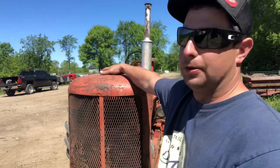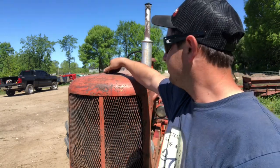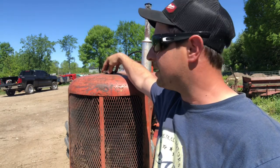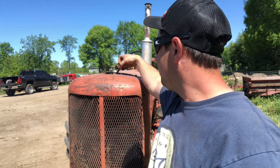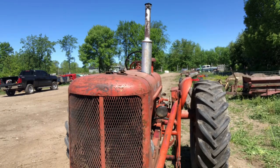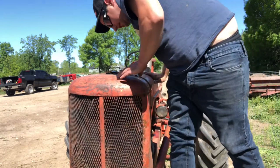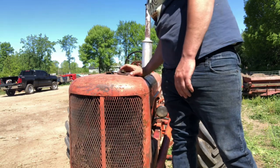So for your first check, we're going to check the engine coolant. If you're in a warm temperature, a lot of people just use water. Here in Canada, we use antifreeze as it gets quite cold. That's located in the top of the rad right up here. You don't want to open these when they're hot — it's really dangerous. We'll pull the cap off, look down, and it's level with the top of the rad, so we know we have lots.